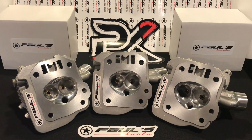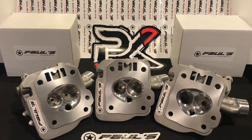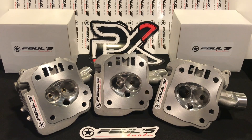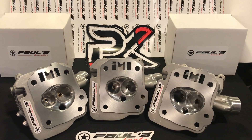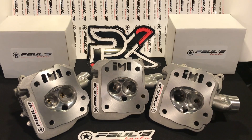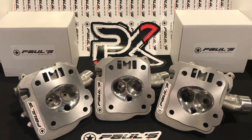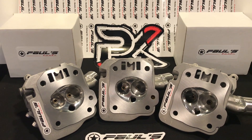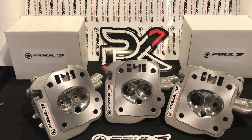Probably in stock condition they're decent, but for the almost $250–$300 they're charging, it's a rough raw casting — it's not a finished product. There are a couple things I like about it, but when it comes to dialing in a cylinder head, it really has to be very specifically done, especially when it comes to the seat and how the seat transitions into the bowl of the head.